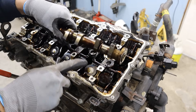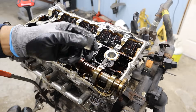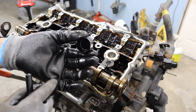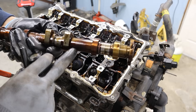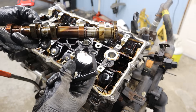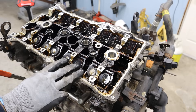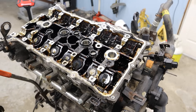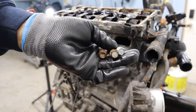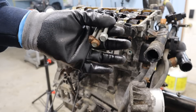Hyundai uses a very simple cam-on-bucket design, so the camshaft acts directly on the bucket — no roller arms, rocker arms, or hydraulic lifters to worry about, but periodically you'll have to shim up this bucket to do a valve adjustment. If you look closely, the tips of these cams are nice and clean, but roll them over and the back is really tarnished like the rest of the engine. That tells me this needed a cam adjustment — this bucket wasn't contacting the camshaft all the time and there was a gap. This design is also surprisingly similar to what Toyota used in the mid-2000s.